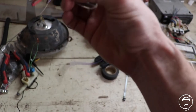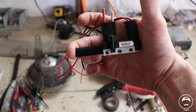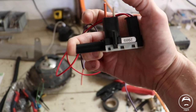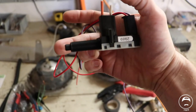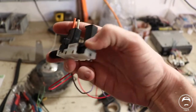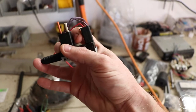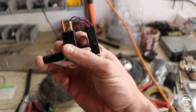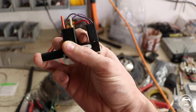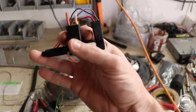When your car is just standing there without use with the foot off the brake, this thing right here is pushed in, which means that your tail lights are off. When you push on your brake pedal, this pops forward and turns your brake lights on. So what the TCC switch is looking for is the exact opposite of your brake signal. It wants to know when you're not standing on the brakes so that the torque converter can do its thing. And if you're running cruise control, it knows whether it can be on or not. So that's what that guy does.